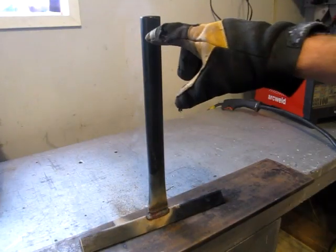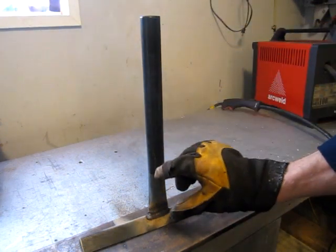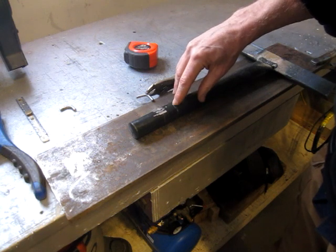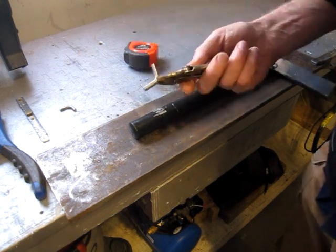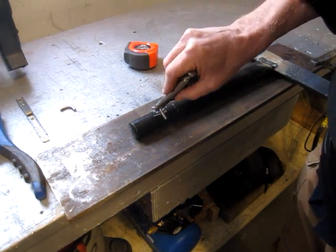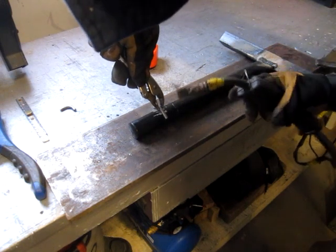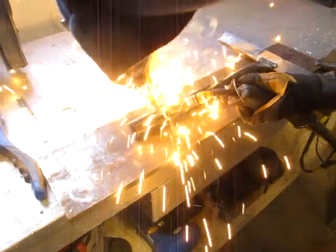That should work, and now I'm just going to weld a couple of bars at the proper height. Maybe keep the back tire about 1 inch off the ground. So with the bottom sitting on the ground and this up inside the seat tube, the mark's right about there, so I bent up a couple little 1/4 inch rods. I'm just going to weld them maybe 1 inch higher, just to keep the bike off the ground enough to spin the tires. Get that one tacked in place. And then do the other side.